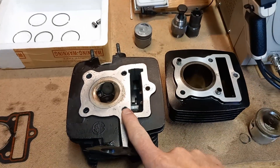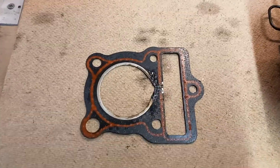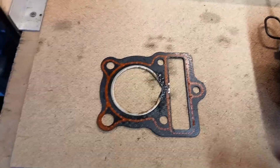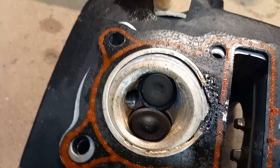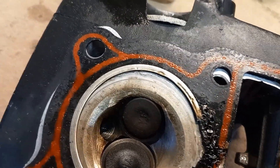There's the cylinder head, the cylinder, and that's where the fault was — it's the head gasket, it's completely burned through. When you look at this up close, you can see that this metal ring in the head gasket has been dented.